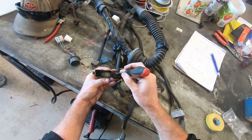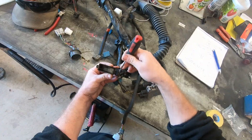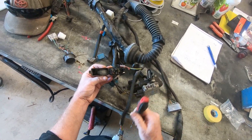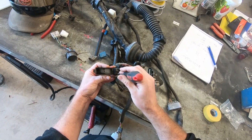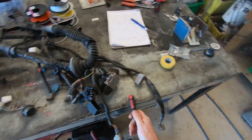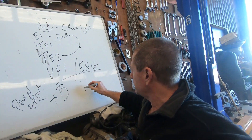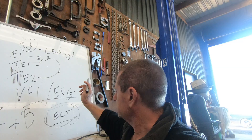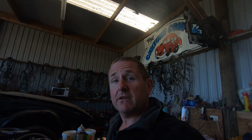But if there is a check light on the dash — which there is on this vehicle from the factory — then you will get check codes. So that will work because you've got TE1 and E1, but you will not get any live data because there's no TE2 to bridge. VF1 is present, VF2 is there. One more thing I forgot to mention: if you want to get transmission info, you need ECT.